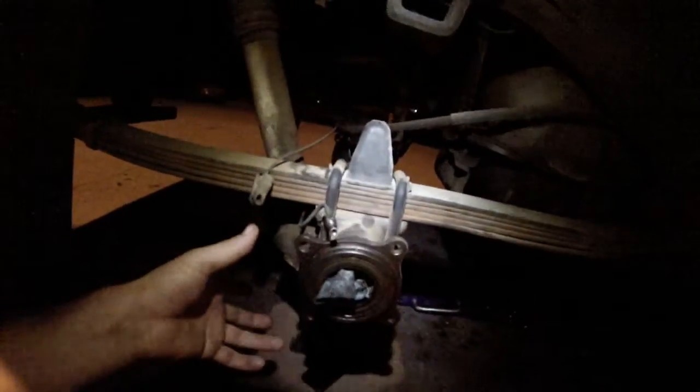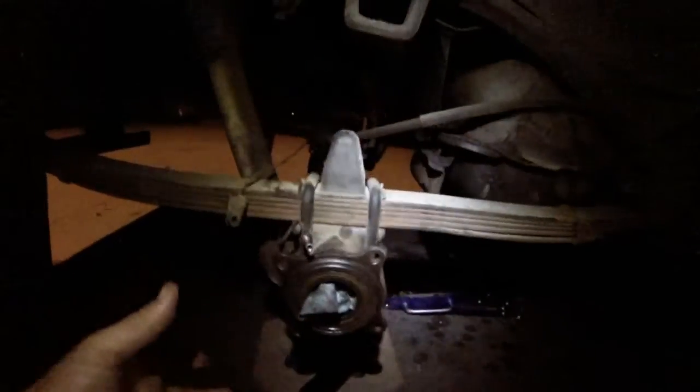Oh wait, no, before you get to these 4 bolts, there's that hub on the lug nuts that can come off because the e-brake is not attached anymore. So you just take that little hub off those lugs, and you can see all your internal e-brake, or rear braking components. If anything doesn't seem right or seems out of place, and you don't like anything the way it looks, or something's damaged, replace it. And it's very cheap. You just have to buy the tools and whatnot. That's a whole different subject. But yeah, just replace it. It's a lot easier. The drum brakes aren't that hard, but I don't like dealing with them. Disc brakes are way easier.